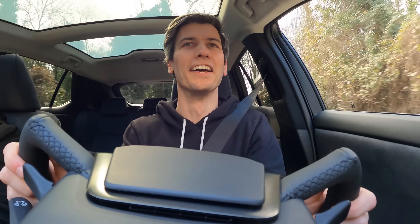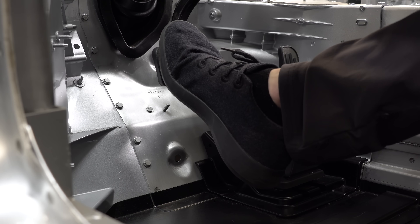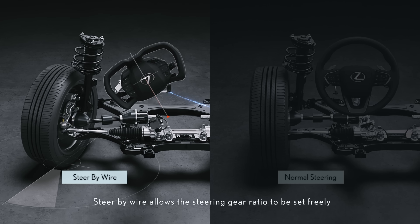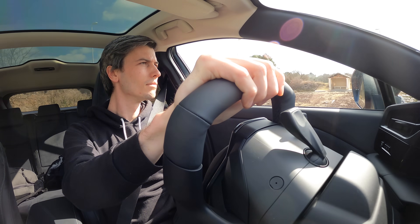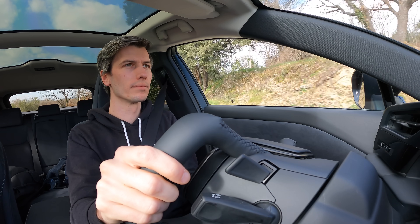The other thing is, I'm pretty convinced folks will either really like or really dislike this kind of steering. It's super sensitive at low speeds. To be honest, I liked it — but I also like highly sensitive accelerator pedals and brake pedals with little travel. I got used to it very quickly, but in the hands of a different driver it could feel very twitchy. As an analogy, if you're the kind of person who cranks your mouse or video game controller sensitivity all the way up, you'll probably like it. If you're on the other end, it's probably not for you. There's one more brain stretch you'll encounter as well: a completely variable steering ratio means the same steering wheel angle doesn't always correlate to the same wheel rotation. There's a curve with sensitive steering at low speeds and more dulled steering at high speeds. Again, I found it easy and intuitive, but I also love things like one-pedal driving, where regen varies depending on vehicle speed, battery temperature, and battery state of charge. A lot of people don't want all of this complexity — they want everything to feel the same always, and here it simply doesn't.